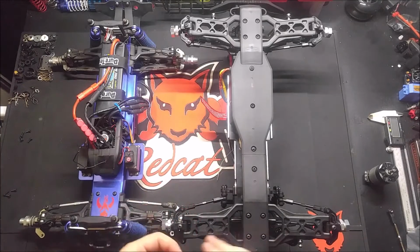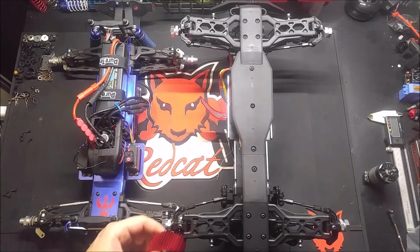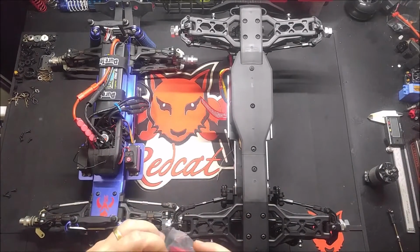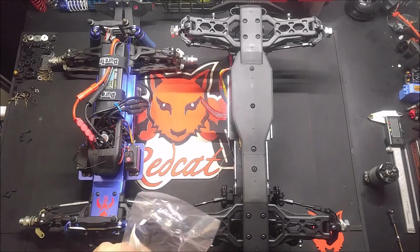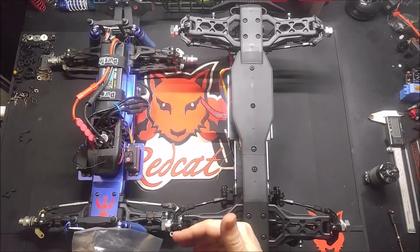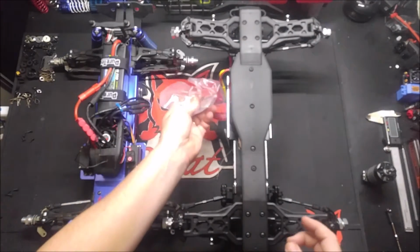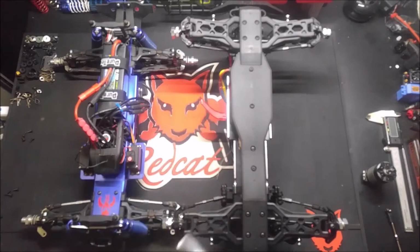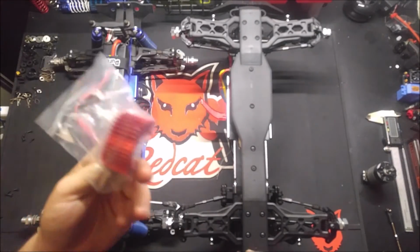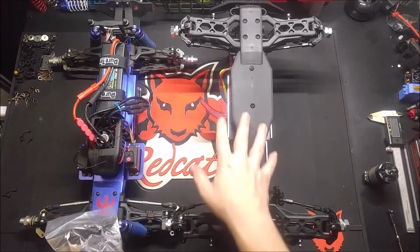You know, unless you're getting like a WTF fan or a high-speed fan, man, don't worry about them cheap fans that come with these. The other setups, I mean, they're really not putting out enough to worry about, and sometimes they cut down on the heat sink that actually could help take care of it, especially when you're traveling on the side. The wind's getting through these, hanging off the side like that, so it's getting airflow through it, man, more than a fan's going to blow just by the design. So most people think that fan's doing a ton to help. It's really not on a setup like this where it's exposed.